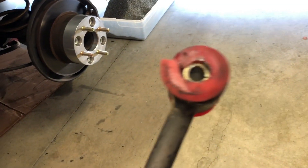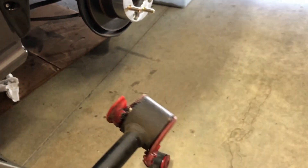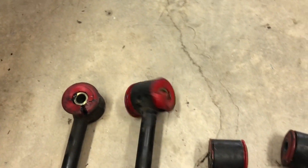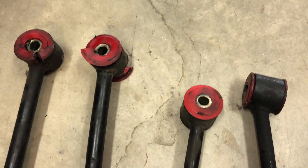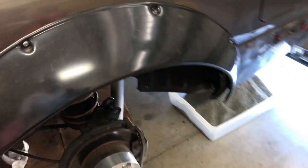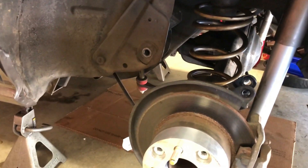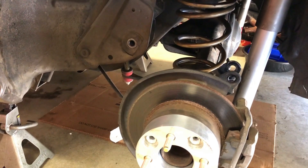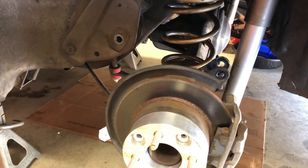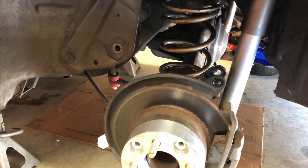All the bushings — these are the lower control arms — they've been destroyed. More of the same here, and the uppers are not as bad but they were still destroyed. I believe this is primarily due to the design of the rear suspension from Mazda. There's some inherent binding, especially when you lower the car, and I want to try to show you that in this video.